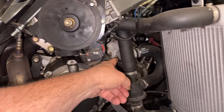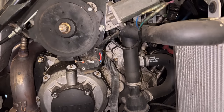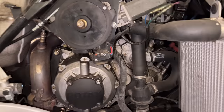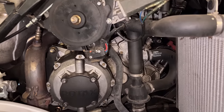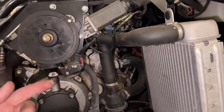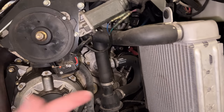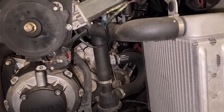The water pump is right underneath there — it's in the cover but it's driven by a gear inside there. I think it runs off the primary gear off the end of the crankshaft. The water pump internal gear is like a yellow plastic — it's not under any kind of load. But where the problem's happening is that seal is failing, because the shaft goes into the engine and it's in the oil bath. When that seal fails, it weeps out the same weep hole it would leak from if the coolant part of the water pump was failing.